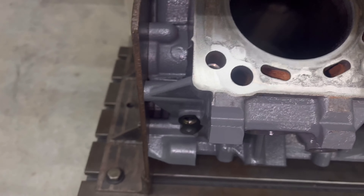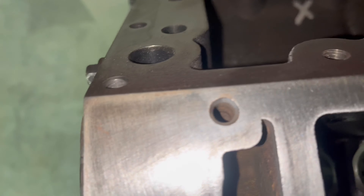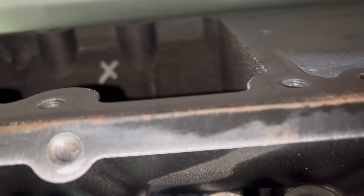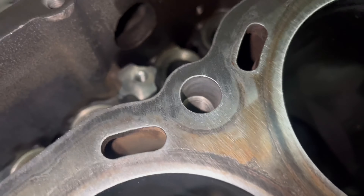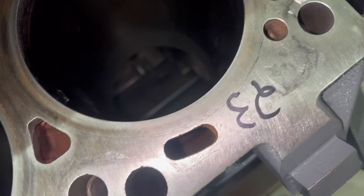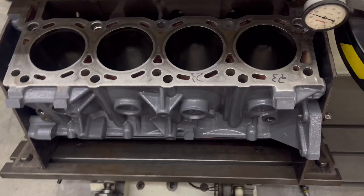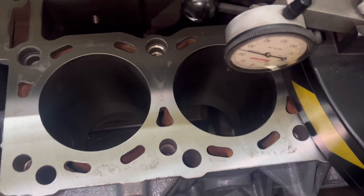This is the other side — should be the driver's side bank. Touched off slightly up here under that ledge. Very slightly touched off a little here. We can see a little right there which tells us we're real close. Got quite a bit taken off there and quite a bit here. We might be a fraction high on this side but it is very minuscule. Let's go down and do another one.